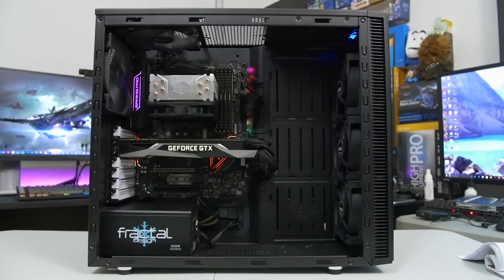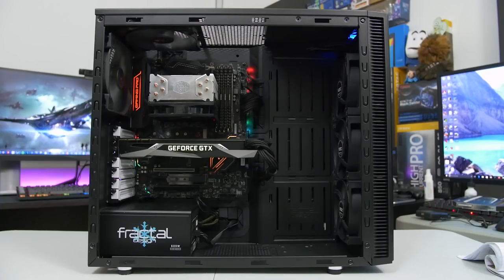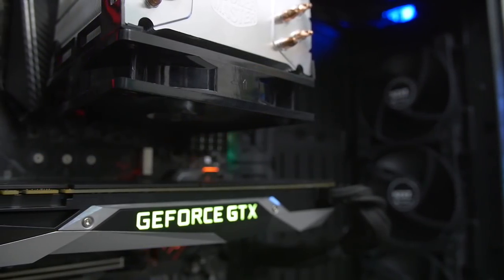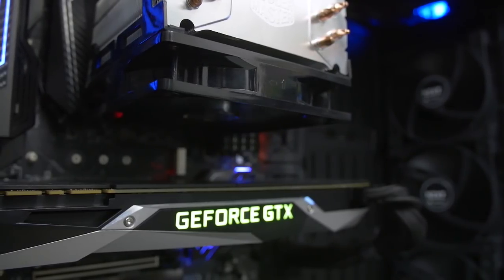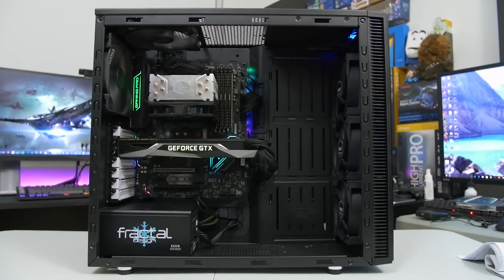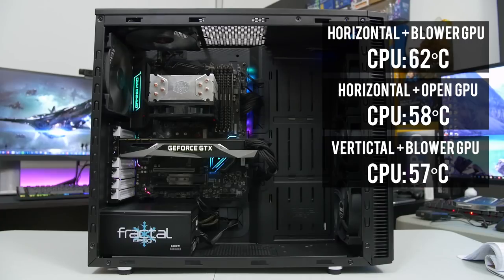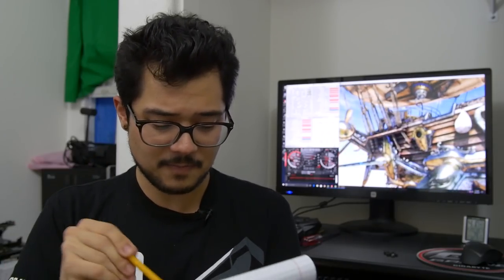The other pair of tests featured the CPU cooler mounted in a vertical airflow position, where airflow travels upwards and out the top of the case, with the CPU heatsink fan parallel to the graphics card PCB and underneath the heatsink, pushing air upwards through the fin array. What we saw with the closed blower-style card was 57 degrees Celsius on the CPU. We went up five degrees Celsius when swapping to the open-air shroud Zotac AMP Edition. This makes sense — if you have more hot air circulating in the case wafting off your GPU, your CPU temps would be negatively affected.